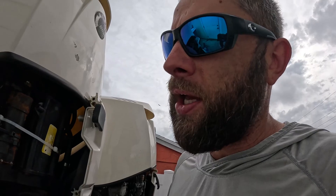That's how you program an injector on an Evinrude E-TEC. Hopefully this helps — it's not really that hard. I hadn't done this in a year or two but I remembered how to do it without needing to search the forums. Now I'm going to pump the primer bulb, get some fuel going through, and start the engine. One last thing — make sure the serial number matches your injector. The software shows injector number six ending in 827, and checking the injector itself it also ends in 827, so we're good.